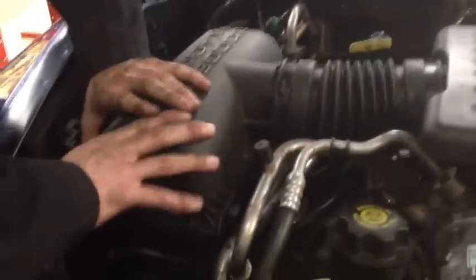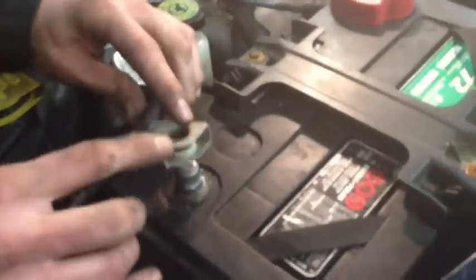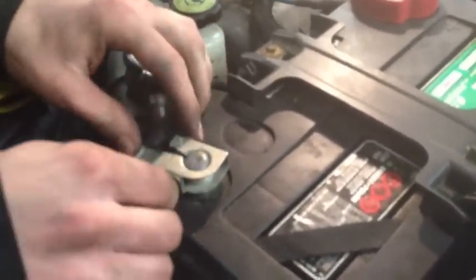So now that you have everything back on, you can start putting this air box back on top. You can now install the air box with the air filter just by this one bolt again. You can now install the air tubing from the air filter to the manifold and just hook it up. So the last thing that you want to do is hook up the battery. Always take off negative.